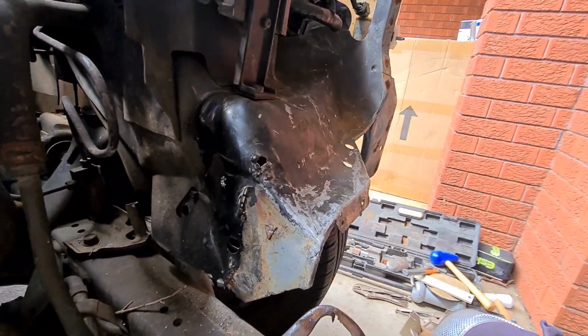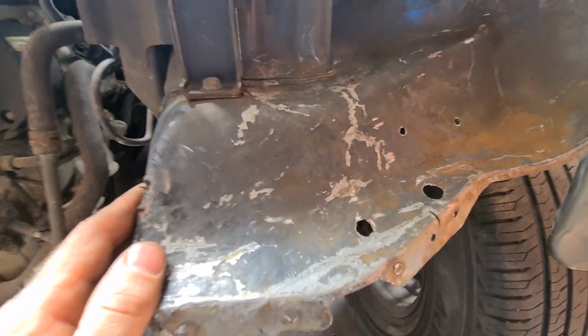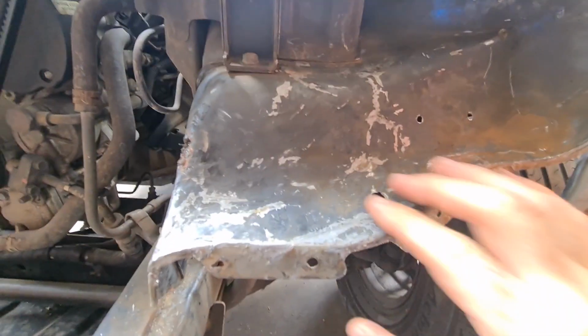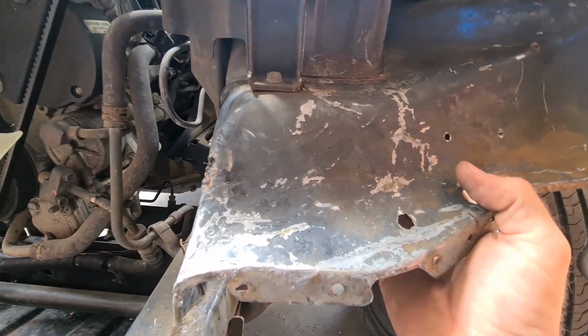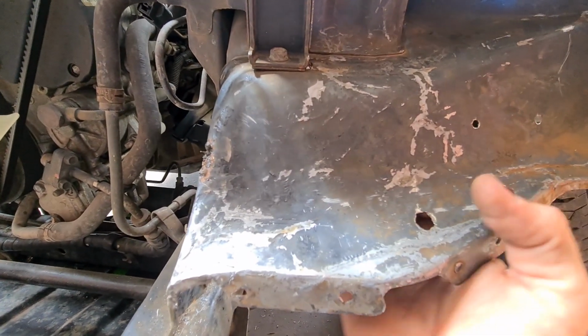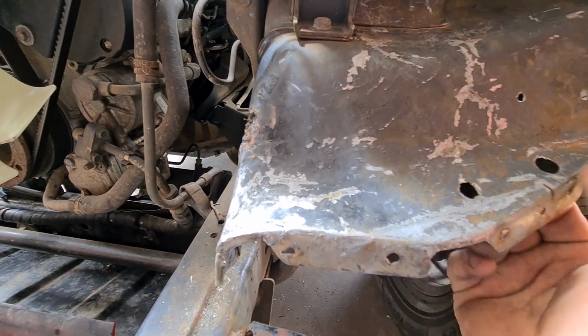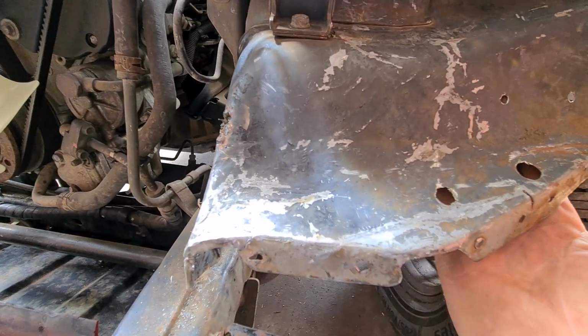Just a reminder, don't smack bang onto your dollies with the hammer, you don't want to hear it ringing unless you're planishing. When you're planishing, you're not hitting that hard. You're still doing the dolly on high, hammer on sort of technique, but you hit it softer and you hit it a lot more times. Lots of smaller taps.